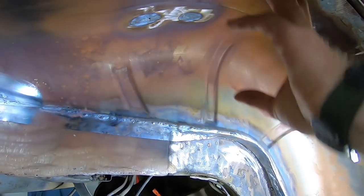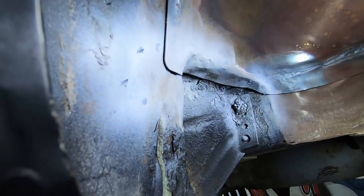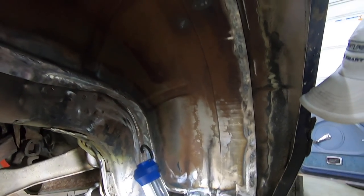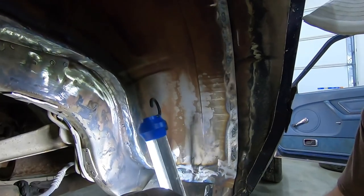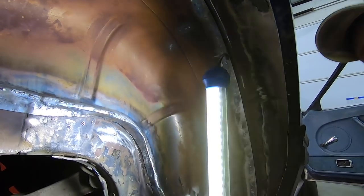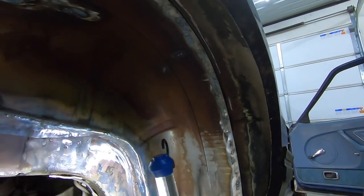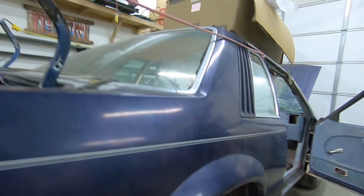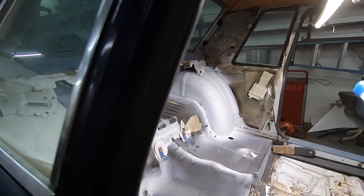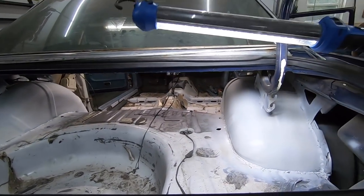This is not what they recommended - we went all the way back and had to notch the frame. As you can see right here, we didn't have to cut any off the outside of our tub. Now we trimmed it off and welded it straight. That is awesome. You can do it several different ways, but he wanted all the meat on it - you're cutting the spring bucket off anyway. They look almost factory, the way they're made, and you've already got the hinge mounts back on them.